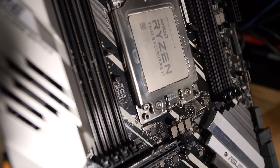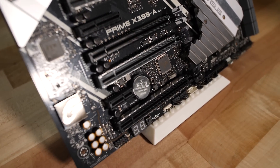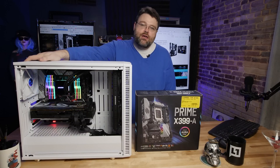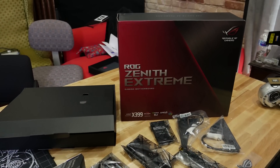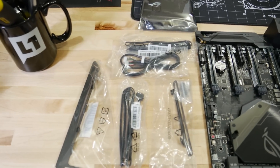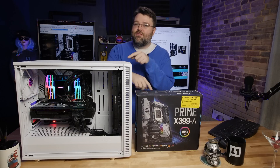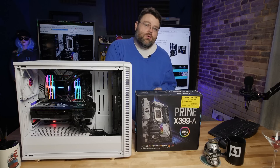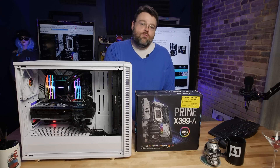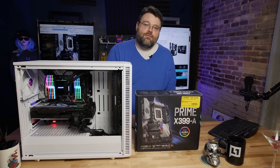Honestly, there's not really a lot to complain about on this motherboard. At the price point, other motherboards will give you multiple Ethernet interfaces. It is an i211AT, which is a higher-end Ethernet interface, but a lot of other motherboards incorporate two of those, or 10 gig, or 2.5 gig Ethernet. The higher-end Zenith Extreme from Asus includes an add-in 10 gigabit Ethernet card, so if you're looking for 10 gig and you want Asus, check out the Zenith Extreme. You do have a lot of PCI Express interfaces to add your own. It might be nice if the x1 and x4 slots were flipped, because then you could run an older Intel X540 — which is PCI Express 2.0 — in that x4 slot and still get 20 gigabits of bandwidth to drive a dual-port Intel X540 10 gig Ethernet card just fine.